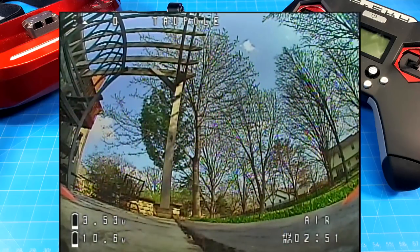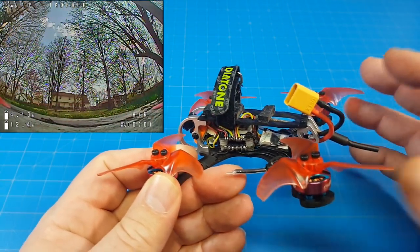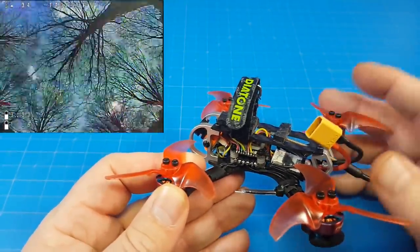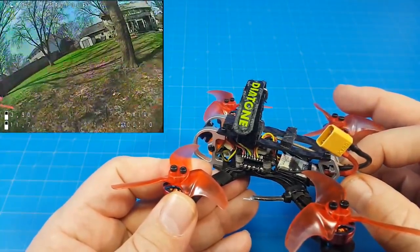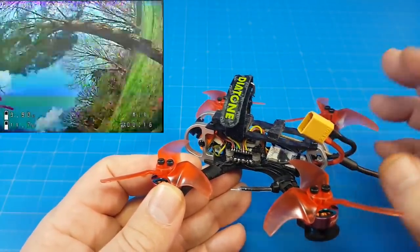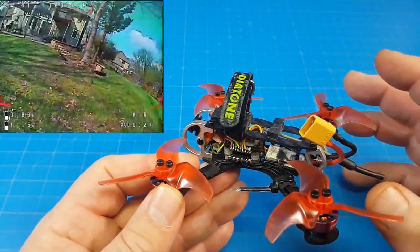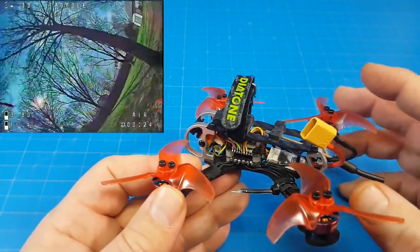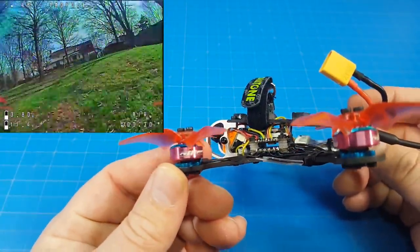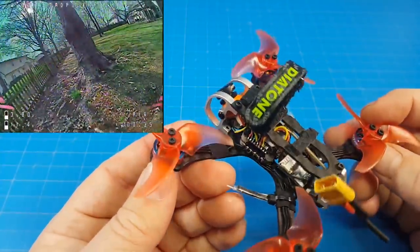The battery starts to recover as we back off the throttle, and when we disarm and go back to the home screen we can see 3.53 volts per cell — the battery is in good shape and we still got almost three minutes of flight. I've also got some footage running without audio where I was just flying at random, and that flight comes in at over 3 minutes and 30 seconds. Flight time is a big variable — with these motors and the same battery I could crank up the camera angle and kill the battery in about a minute and 20 seconds. These motors, while they're pretty, are just not very efficient.